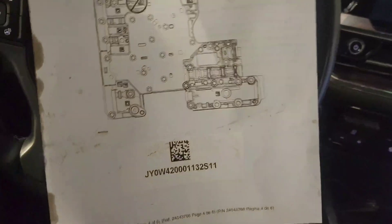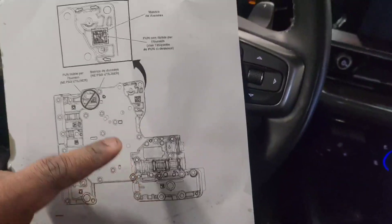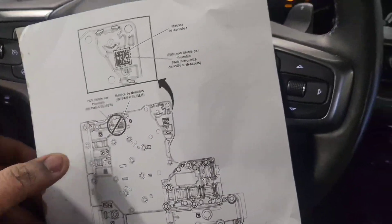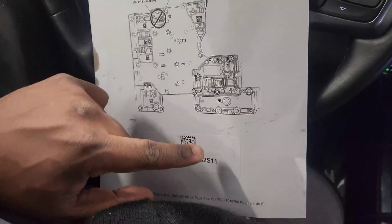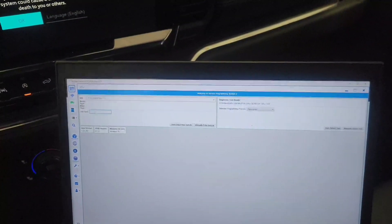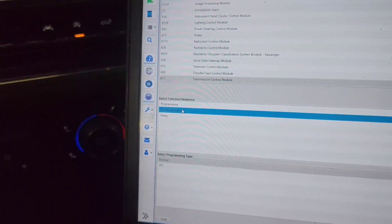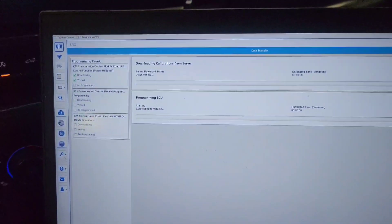For the solenoid you need a special calibration number before programming. Sometimes GM sends that paper with the code, but you also have to get it from the barcode on the valve body. I install the calibration number — they call it a TUN or PUN — to program the solenoid and the Transmission Control Module, TCM. On the scan tool it says 'replace valve body' and asks for the part number.